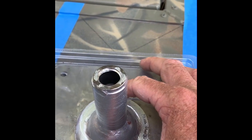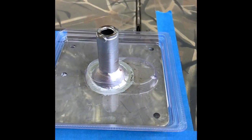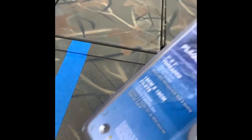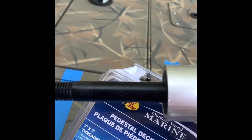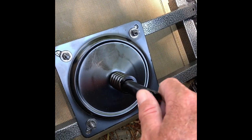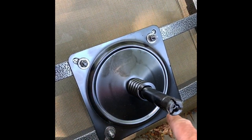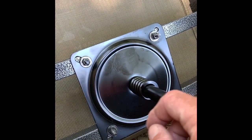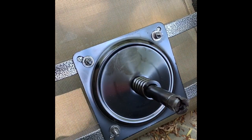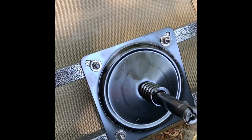The base itself is two and a half inches wide, so I've got a two and a half inch hole so it will fit down flush. I took the base, set it there, got my marks — and this is going to flip over of course. This is a screw-in type for the base, and this is what the bottom of the base looks like. The seat will just attach right there to the top part. It's 13 inches long. These are Bass Pro adapters for the bottom of the seat. The four bolts come with the seat. The seat's about $100 and it comes with the washers and the nuts. Both sides are 7/16ths. You can use a crescent wrench on the bottom side underneath the seat, and I used a deep socket 7/16ths to tighten down the nut on the other side.